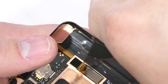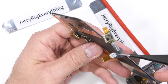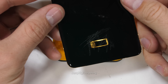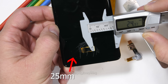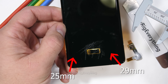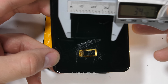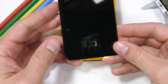Even with all my attempts to get it off, all I managed to do was rip the cable. There's no replacing the ultrasonic fingerprint scanner — the glue holding it to the underside of the display is pretty permanent. One interesting thing: while the screen is taken off, you can see the exact location of the ultrasonic rectangle when light is shining on it from behind. The sensor is not positioned in the middle like you might expect — it's actually 4mm closer to the left side of the phone. The off-center rectangle is because of where the ribbon was connected to the sensor. The ultrasonic sensor is indeed centered on the phone; Samsung just added a little extra space to the left for the ribbon.